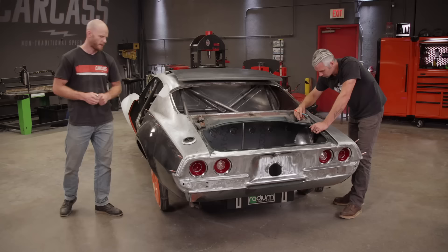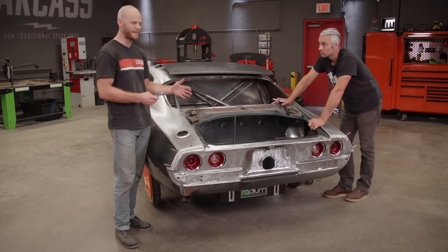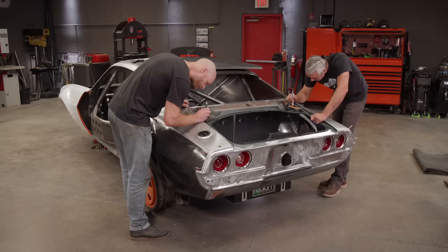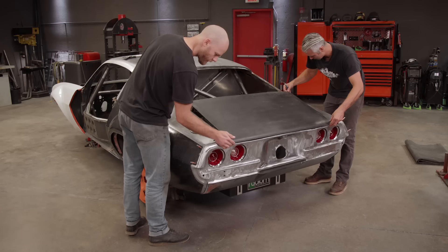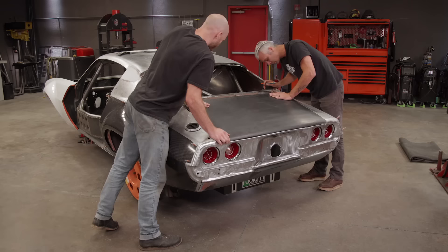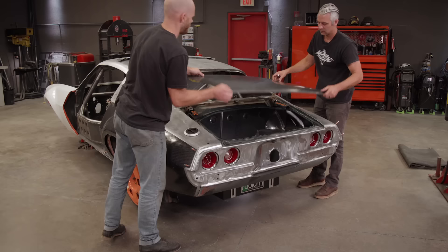Now the next step is to figure out a way to get our holes transferred onto our deck lid so we know where to drill them for our rivet nuts. We think the best way to do that is to use paint pens, color the top of the hinges, put the deck lid on it, give it a nice press, and hopefully that paint transfers to the underside of the deck lid, and then we'll know where to drill the holes. We did end up putting a little bit of paper towel under there with tape so it can kind of conform. After drilling some pilot holes, I'll go ahead and drill to the final size for the rivet nuts. That is the install of our carbon fiber deck lid — this thing's looking really nice. Got about a 3/16ths gap all the way around, which is perfect. Now we just need a way to latch this thing down.